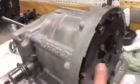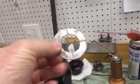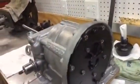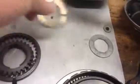In the back of the pump there is a Selective Thrust Washer — basically a Babbitt-type bearing. This is an NOS one. It fits on the drive drum back in here and lets the drive drum move in and out and run smoothly. If you have the wrong clearances in there, it wears that washer out prematurely, like this washer that's completely hammered — which is the one I took out of there. When you look at the two washers next to each other, you can see this one is severely worn and beat up, and that's why I replaced it.